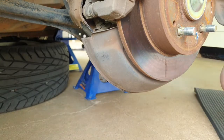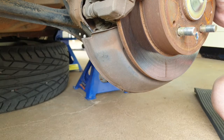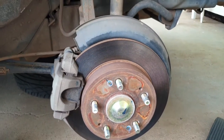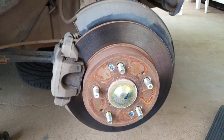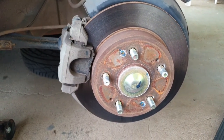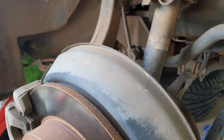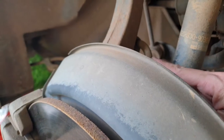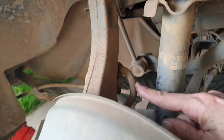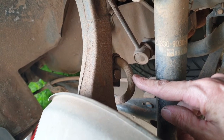Alright guys, loosen that off, get that bottom bolt out, loosen the top one off, but leave it in there for a bit until we come back. See you soon. Okay, so I've taken that bottom bolt out that holds the caliper on. I've left the top one in loosely, just to hold it on there, not that it's going to go anywhere, because if you have a look in here, there is a retaining screw bolt holding that on, and we need to take that off.